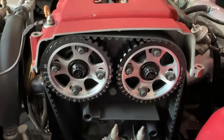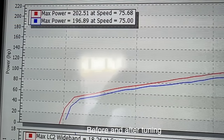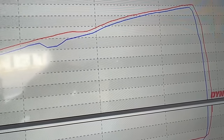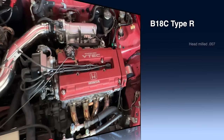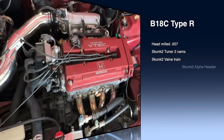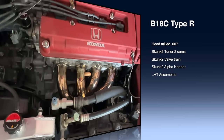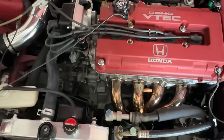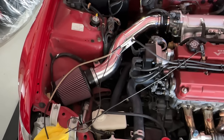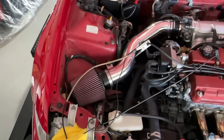This is a fantastic sounding B motor — this is what Honda is all about. This is what we call the OG VTEC B-series sound. This is essentially a slightly high-compression Type R motor. The bolt-ons are Skunk 2 202 cams, Alpha springs and titanium retainers, Skunk 2 LMAs, the Skunk 2 4-2-1 Alpha Version 2 header — gives it the best ground clearance, very OEM-style header — a cut-up intake manifold, a slightly cool air intake that we built, a high-flow cat, and then the Revel exhaust.